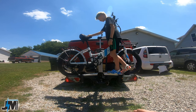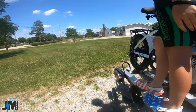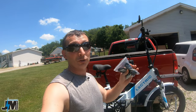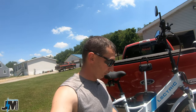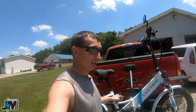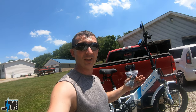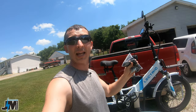Once the rack is up in there, it is pretty sturdy and doesn't have many wobbles. You guys definitely want to make sure you use the strap they give you to strap your bikes down securely to the main bar of the rack. That goes for any bike rack — you never want to trust just the wheel holders. You always want to strap it down because going down the road with all the bumps, there is a lot of movement back here. This is definitely extra security that I highly recommend. Never skip using a strap in addition to the clamps.